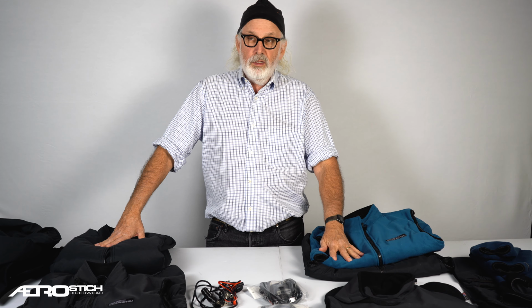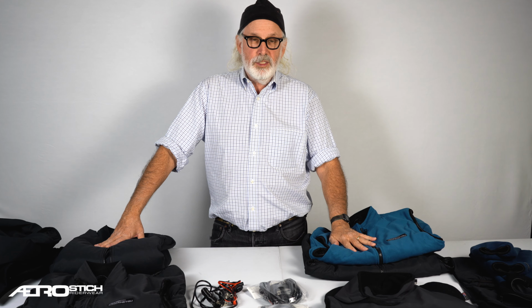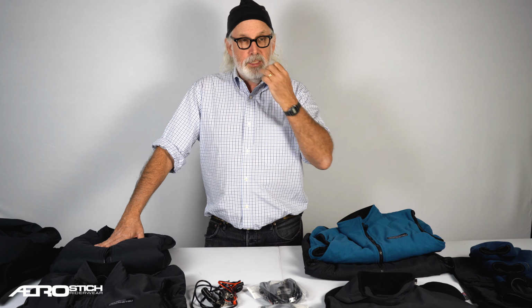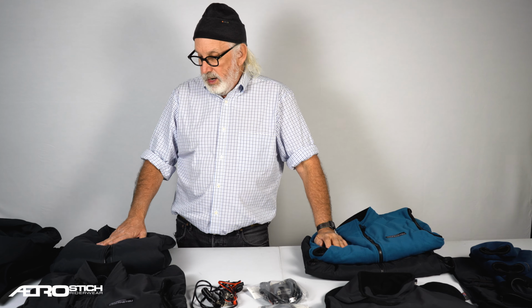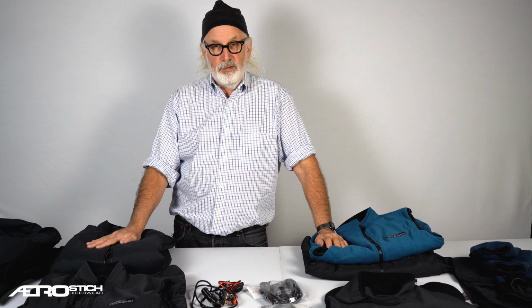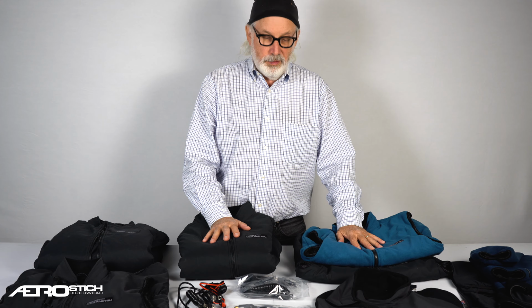And if you want a lot of electricity out of a smaller bike, it's a big job to take the engine apart and change the stator, or on the BMW airheads, to make the alternator produce more. You can do it, but it's a lot of work. Our solution is just to have a little less power and have it fit better and transfer the heat more efficiently to your body.